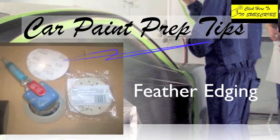Once it's all washed and contaminants are off, then we can continue our repair process. Now, in another video, we talked about dent repair. We repaired a dent, and then we put body filler on, and then we finished it out with 150. Now, it doesn't have to be 150. There's a range of grits of sandpaper that you can use, anywhere between 150 and 180 or even 220. That range is used to finish out the body filler before applying primer surfacer. So for this video, we're just going to say it's sanded with 150 and it's ready for primer.